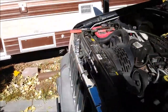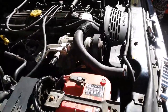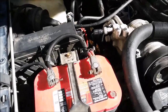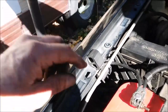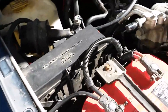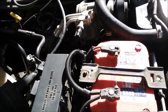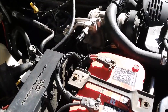Okay, I got the alternator put back on. I had it checked at O'Reilly's and they said it was good. So what I did was clean all the negative and positive connections — the lugs on those and the ones back up in here — a few down there by the motor mount underneath the coil. Those were kind of dirty, so that could have been the culprit. That saved me $111 on a new alternator.